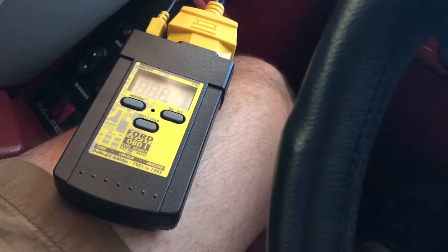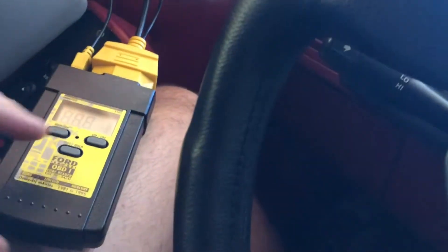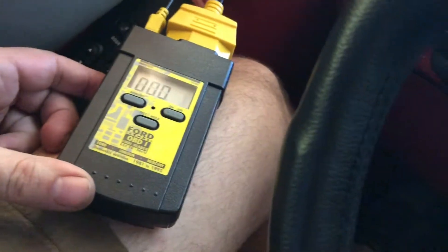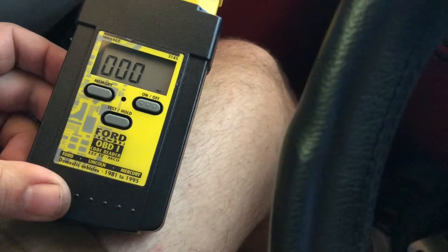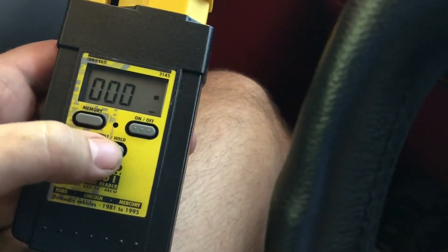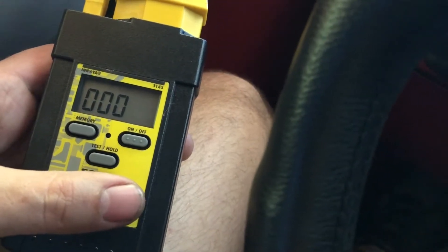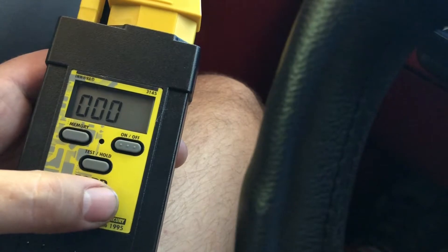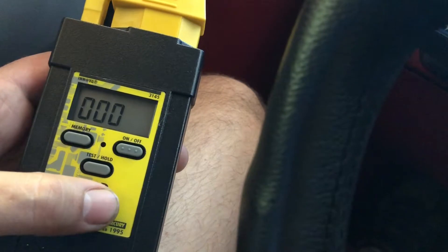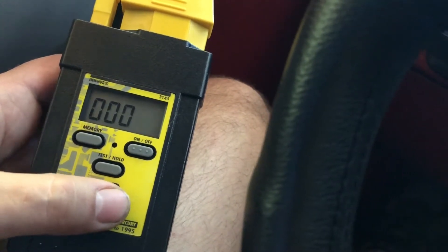With the reader plugged in and off, turn the key on. Turn the reader on at zeros and start the key-on engine-off test just like you would do normally. Push the button to start the test — you'll hear it ran the fuel pump, that's working fine, and you hear some solenoids clicking under the engine compartment. The one different thing we're going to do is, once we start reading codes, put the test on hold. Once you see the square start blinking — that's like your check engine light blinking along with it — push that test hold button, and that will wipe out all of your codes. Now I'm going to unplug everything, take this for a drive, and then perform both the key-on engine-off and key-on engine-running tests. Hopefully we're showing no codes other than those we've already discussed that I'm not concerned about.